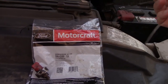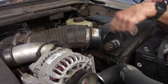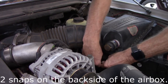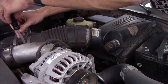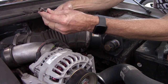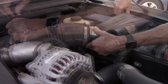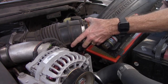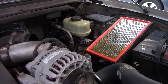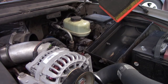It's a piece of cake. Take the airbox out — take this hose off, it snaps off. Should be going over here somewhere. Probably needs an old 10 millimeter but I'm using a five-sixteenths — yeah, that fits. It comes off quite easy. The filter should be in good shape — I've got some leaves in here though.